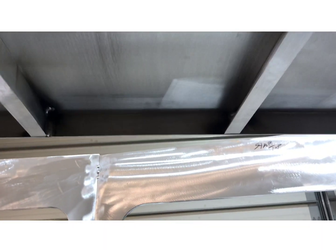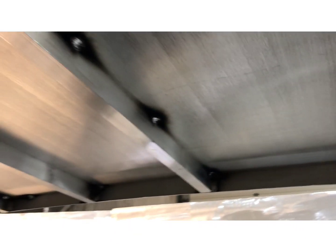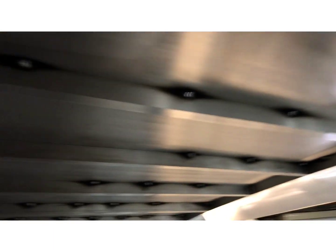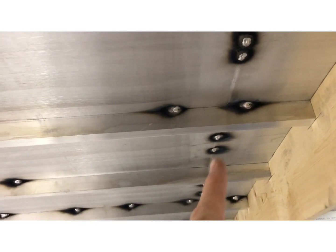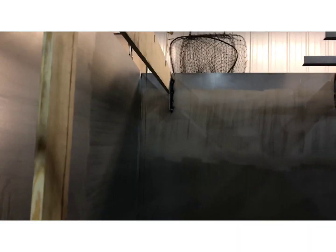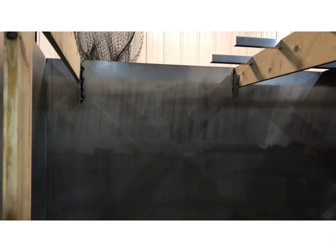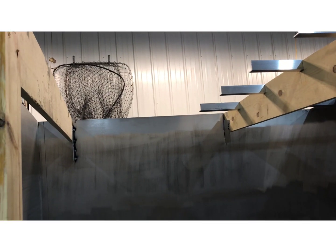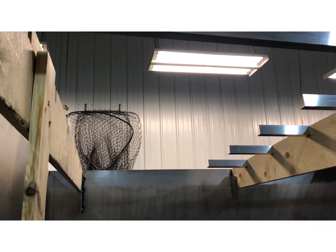I'll stitch this about one-inch stitches every two inches, then weld the top out all the way with the Pulse MIG. I'll put the cap on the seam here — run that molded cap right on top from the outside to hide the seam. But I've got to start my bathroom before I come back any further, so I can get these sheets in and placed all the way down and get the wall and door area done. That way I don't have to fight it when the ceiling goes on — I can just lay the aluminum right on it.